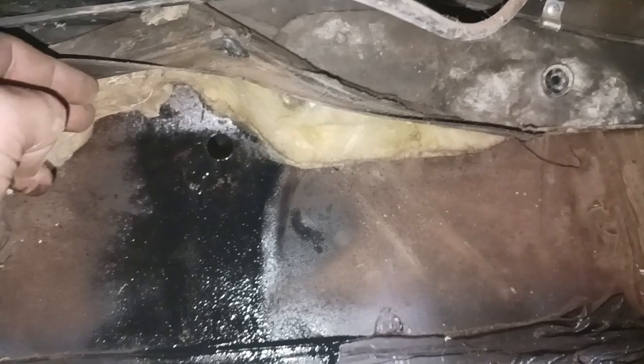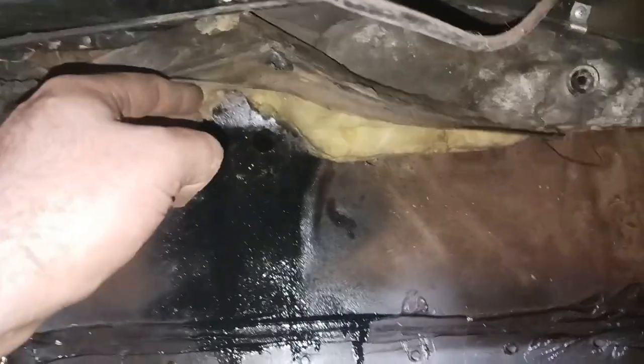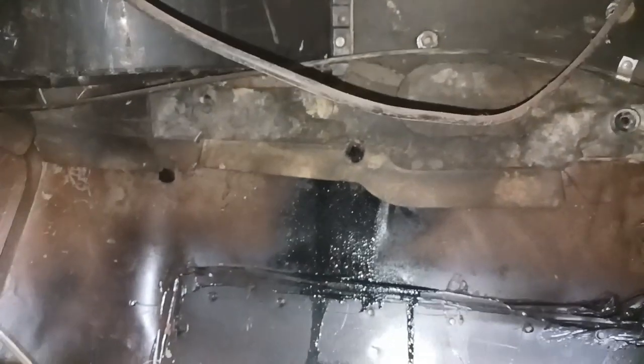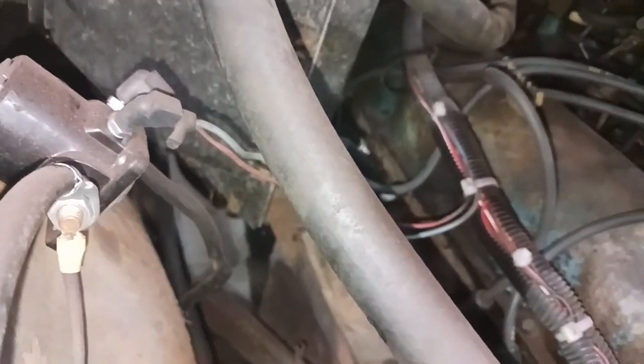Got a hole punched through there below the heater box — did not hit the heater box. I sprayed a little paint on it, let that dry. A man probably should buy a grommet to put in that, but we'll wrap it with a little extra electrical tape, paint it real good, and put some silicone on it, because I'm not spending money on grommets. We'll probably fill this other hole while we're in here. I think that hole might be big enough to get both wires through. Looks like I guesstimated about right — wire came out directly beneath the heater box.